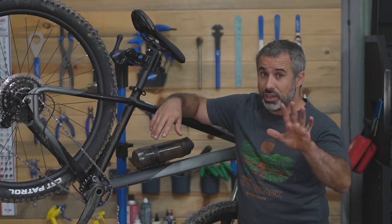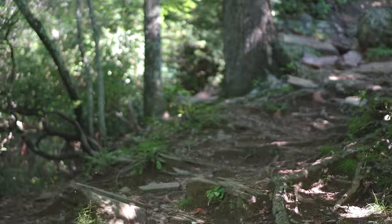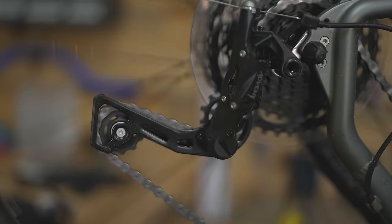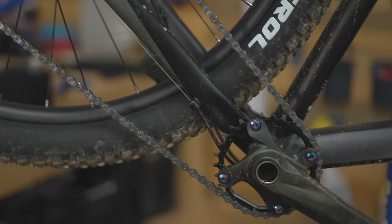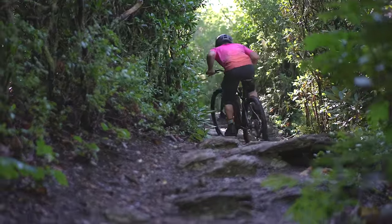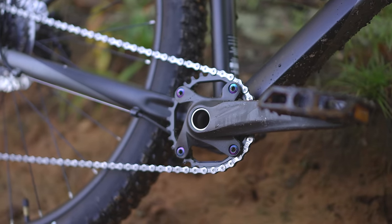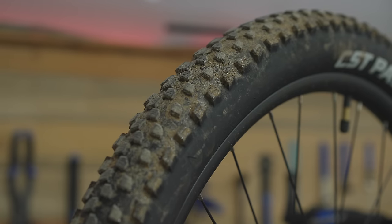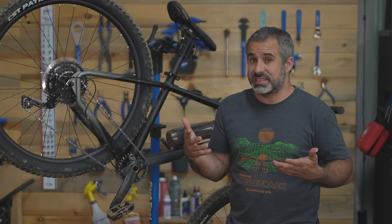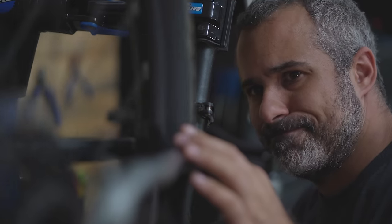Let's take a look at what's actually wrong with the bike at this point — they're all kind of minor things. I crashed, so the derailleur hanger is a little bit bent. We'd just need to put that back into alignment and the shifting should be fine. The bottom bracket is perfectly fine — that was a huge upgrade for $55. It definitely feels more robust; the bearings have a wider stance, effectively making everything stronger. We've had no failures. We did not get a flat tire. The tires held up. Both the front and rear wheel have a little bit of wobble going on, but after a true, they should become stronger.